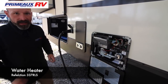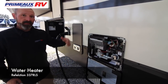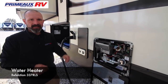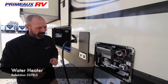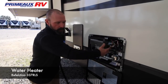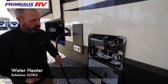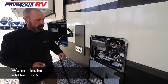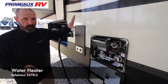Here is your hot water tank. On this model, you do not have an anode — you're going to have a plastic plug, so that means you have an aluminum tank. This model works off of gas and electric. If you ever want to winterize it, you're going to pull this relief valve, let all the water out from that pressure, then pull this plug and let it drain. One thing you want to do before that is make sure the electric side is off — if you leave it on with no water, it's dry-firing and it's going to burn the elements.